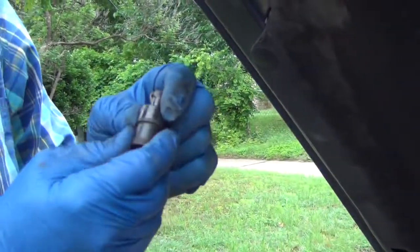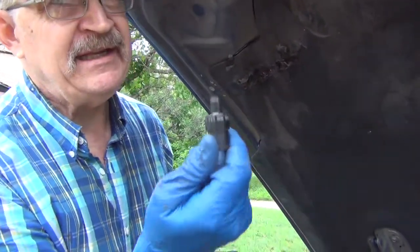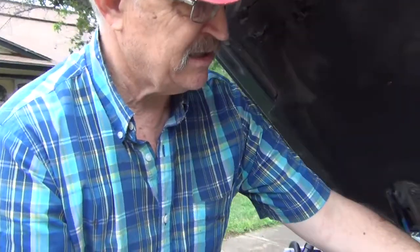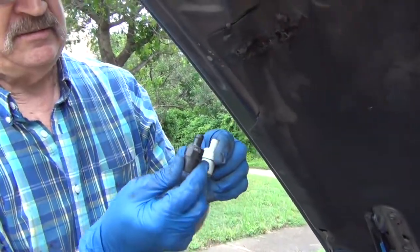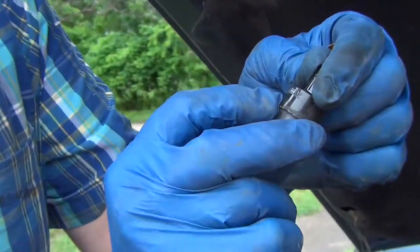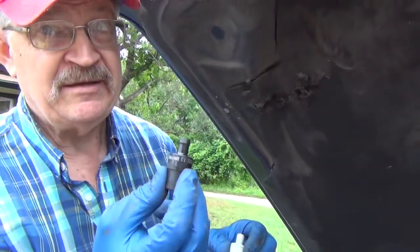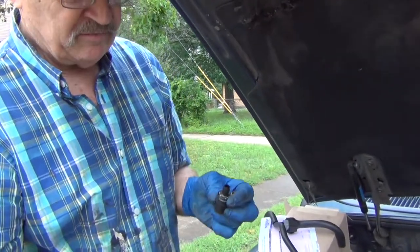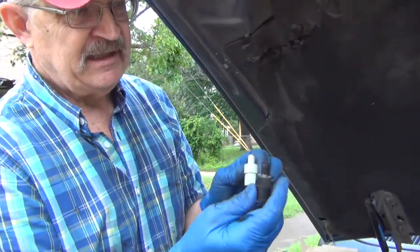They're a little bit different. If you want to, I would go get one of these from a 2000 Ford Explorer and put it on your 1998 — and also I understand maybe the 1999 Ford Explorers are the same way. This is the single overhead cam 4.0 liter engine. This is a $2 part, or $2.50 part — this is a $2.25 EV 225. So you might get that and replace it, and you might be good. If you want to try it for $2, you can heat this up in some hot water and put that on there.